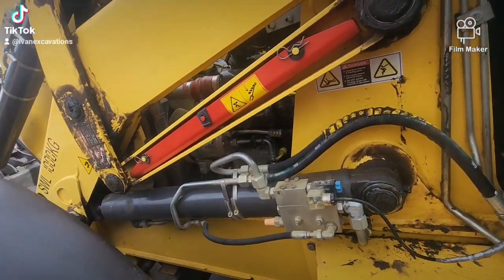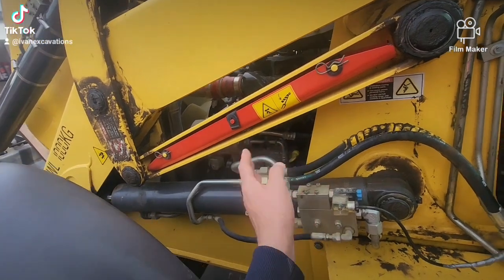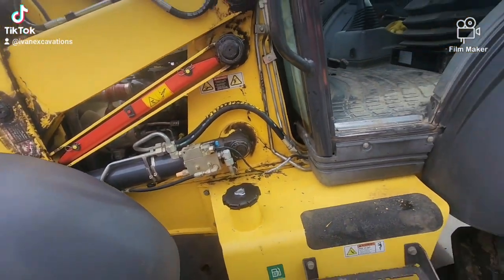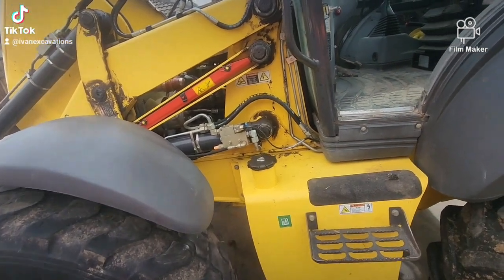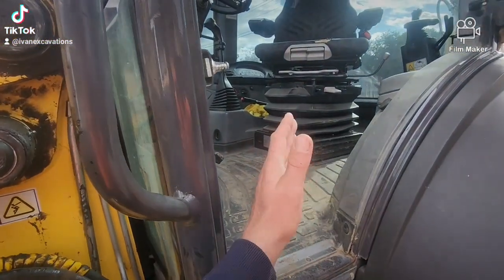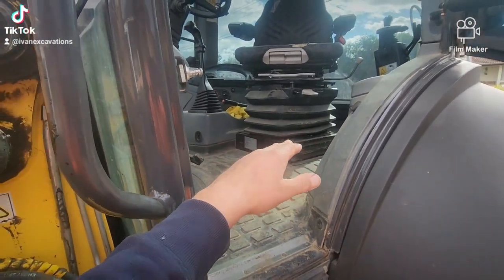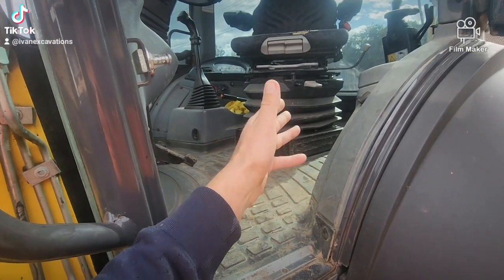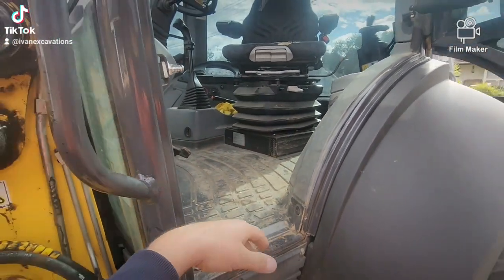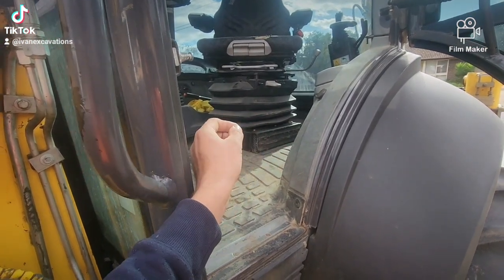So I bought a UV light and put some dye in the system. I couldn't find where it's leaking from the outside. I believe when I put the evaporator in there, I either touched the evaporator or the condenser somewhere — I'm not sure which one — and made a small hole in it.